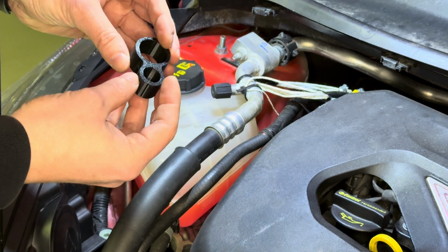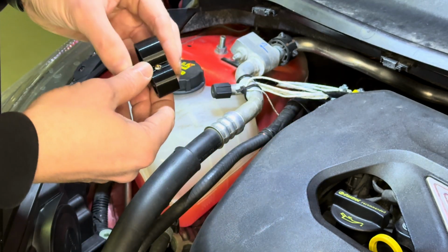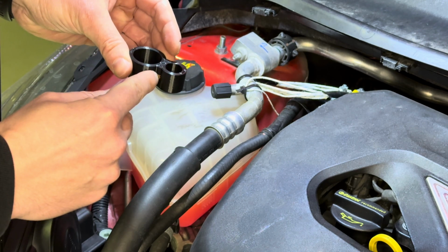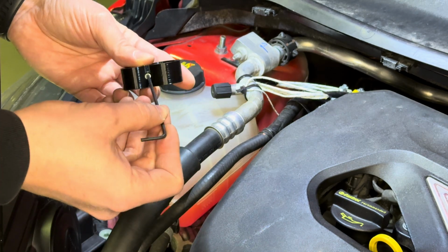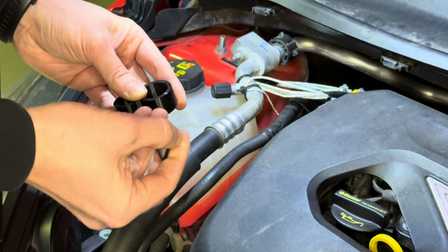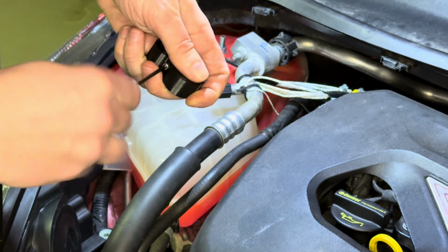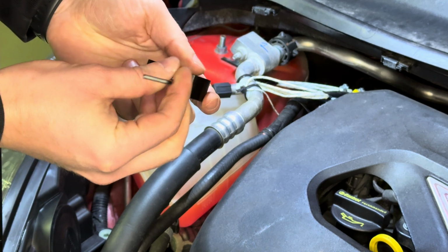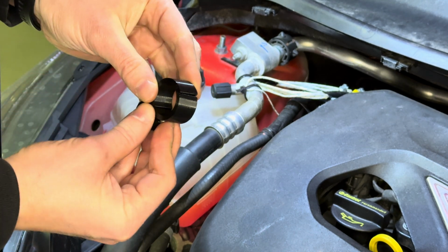The other thing to take into consideration for designing this, quite a simple bracket, was the holding force. There is a brass insert put into the plastic to hold it firmly, and you just have one bolt. You use a 2.5 mil Allen key. You undo it. You split the bracket. And what I also wanted to do in this case, because this is an engine bay, I wanted this to look a little bit nicer, is that it is interlocking on itself.